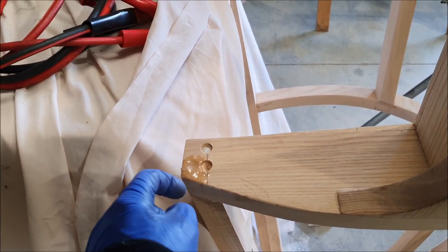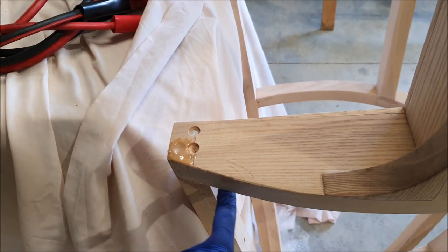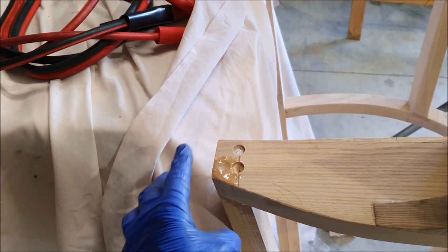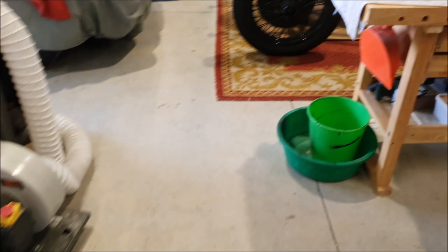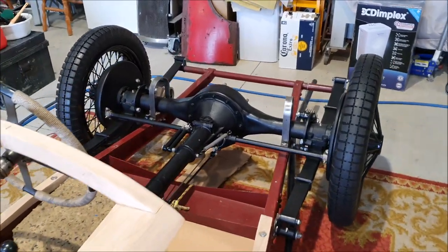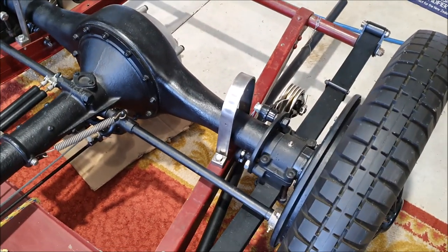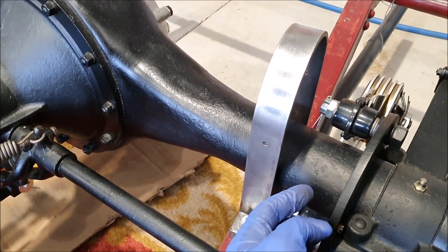I did have an extra screw hole there; I've moved where the screws go through and I can just radius that corner - the epoxy is just there to fill up the previous screw hole, it'll all sand off smooth. This is also going to have a steel bracket on the inside so I'm not worried too much about strength. It only needs about a quarter of an inch to clear that bracket and the nut. It ended up very messy doing things on the mill, cutting up steel and bits and pieces. I'll paint those black now as they're finished, then they can be permanently bolted onto the car. I'm using three-eighths BSF bolts, which are probably overkill, but if the axle ever comes up and hits this you don't want them going anywhere.